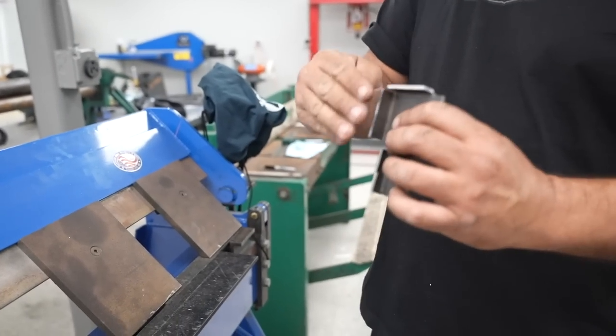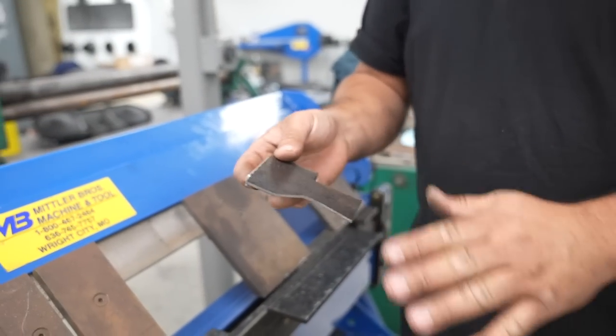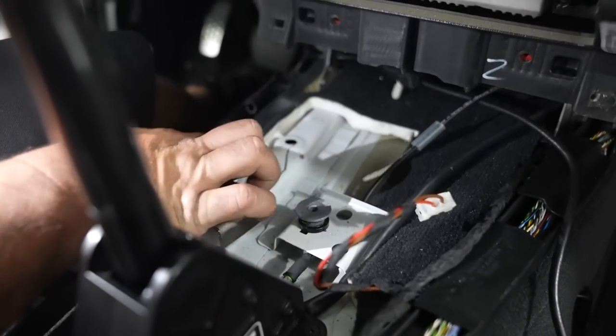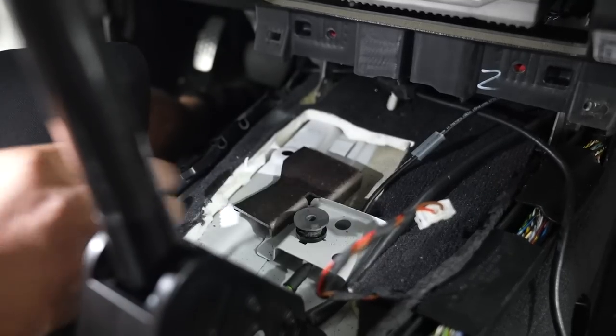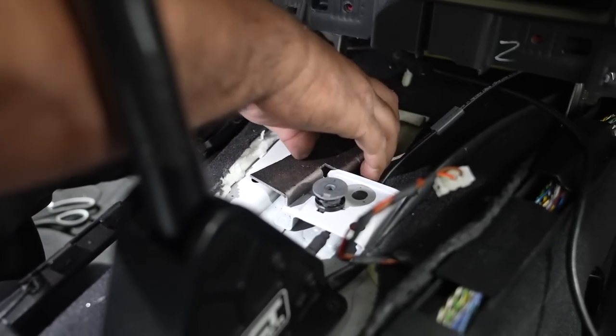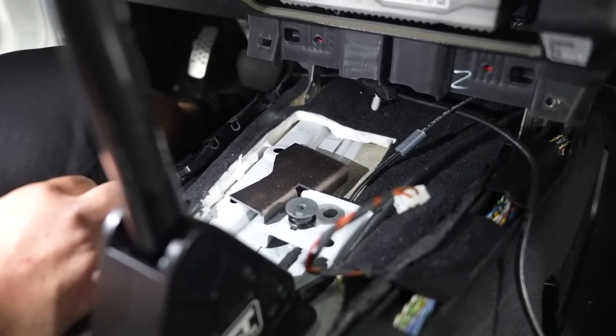So now this gets on the car, we could mark it up, grind in a couple of spots, prep the car for welding, and then make sure this is taken care of. Fiddling around, just throwing it on there. I gotta delete this hump right here that is part of the chassis, but once that is deleted, the bracket will fit pretty good. Just grind it down in some spots, but I could feel metal to metal all around. We're solid with that. Once I get that tweaked out, I could go ahead and finish the bracket and weld it in. So that's pretty good. Now we get it to finish. We could make millions of these